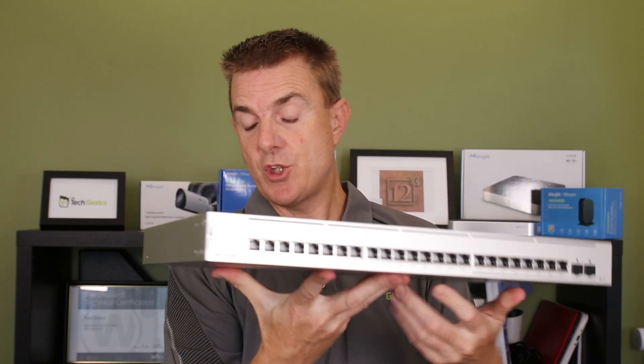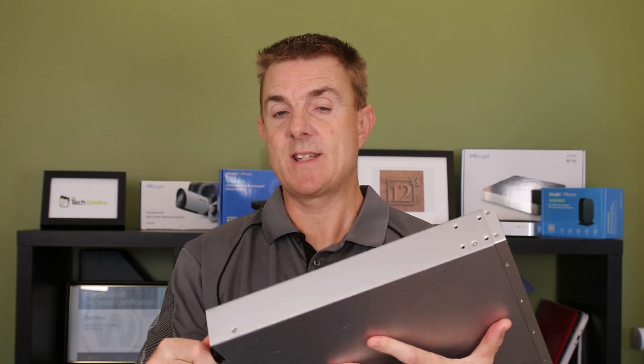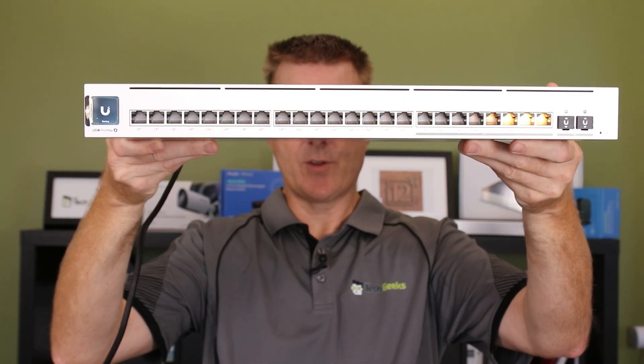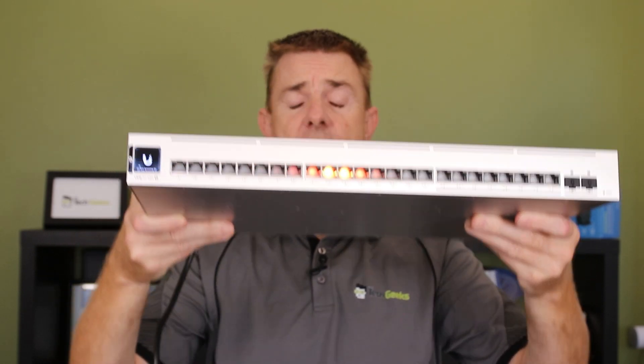So that is the unit itself. Let me just add some power to this so you can get the idea. There's cables coming for this called the ether lighting cables. You'll now hopefully be able to see when I plug this in and it powers up how the lights work. This takes about three minutes to boot, so I won't hold on all the way. But the idea is that once you've defined the colour at the back — you can see all the different colours it can go through — you assign them to a VLAN or whatever you want to show. Each one of those ports can then have a unique set of colours or a grouping. So you've got three at purple and you know those are for your VLAN 4 or whatever, and you plug those cables in.